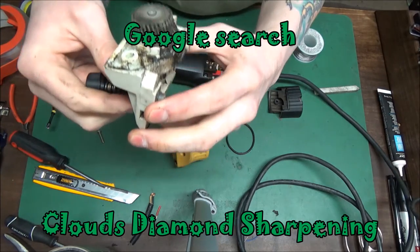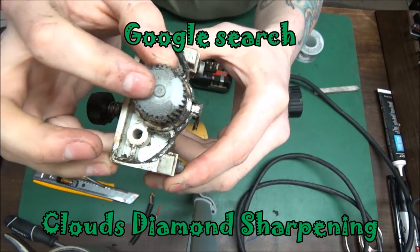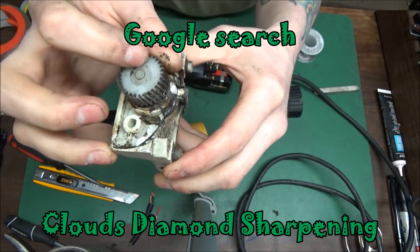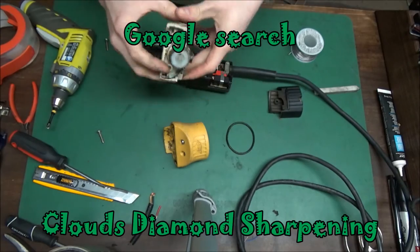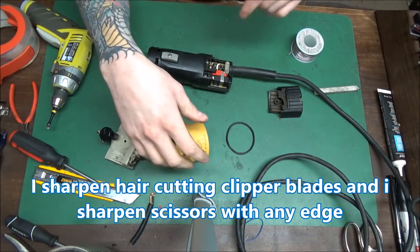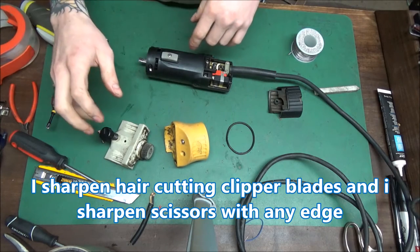Check and see if the gear is cracked — which it is not, so that's good. You've got to move all the debris and you can see there are no cracks. If there are cracks in here, you're going to have to replace it or it's going to make a lot of noise and will pretty soon stop working once it loses the teeth.